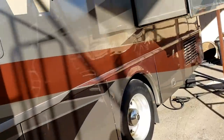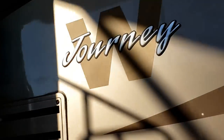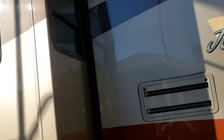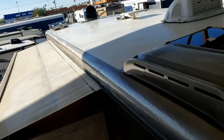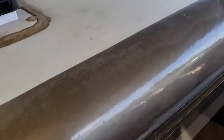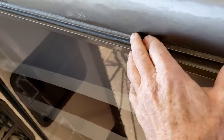Okay, with those slides out now, we can see what I'm talking about. The sidewall ends right there — pretty simple. It ends right above up there with a little piece of molding, just like it does on the other side. I don't know why it delaminated — usually it's going to be a water issue, so I have to figure out why it was leaking too. But if we take a look at the roof radius, this 2006 roof looks like it's in really great shape. Even more surprising, this looks like the original roof radius sealant, and it's still intact — it's not loose.